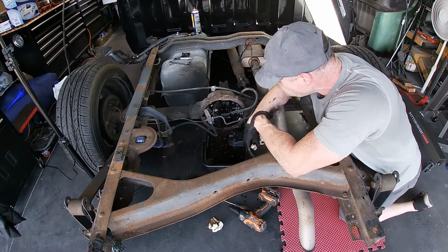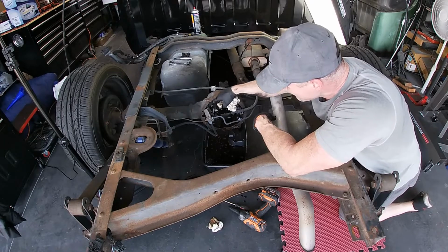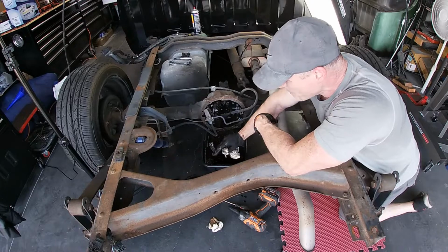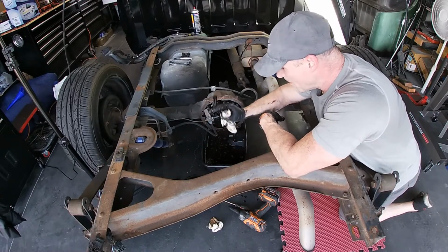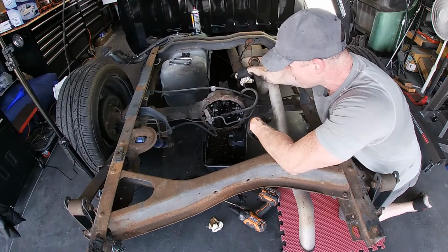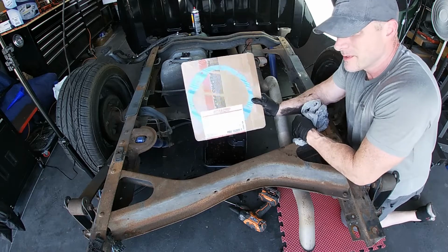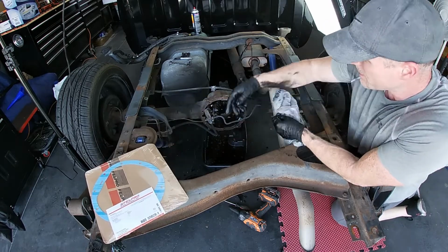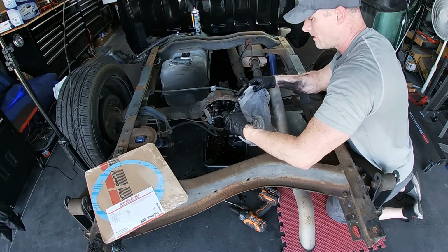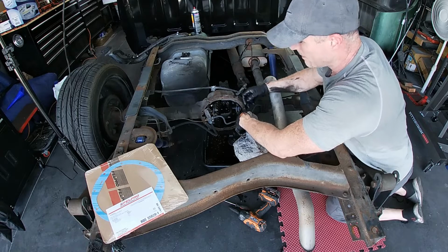So I guess the way I'm going to do this is I'll probably cover this up with a shopping bag, clear off the excess garbage off of here, and get this old gasket completely removed. It's pretty much permanently a part of the metal, and then we'll reseal this up and start working on the front end. All right, we got a Felpro gasket, which is going to replace our old one. We'll put that off to the side. Just a plastic bag, to make sure no additional garbage gets in here while I'm cleaning off the outside of the housing.